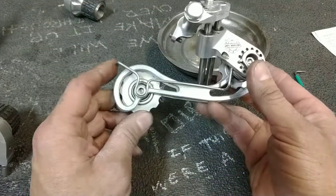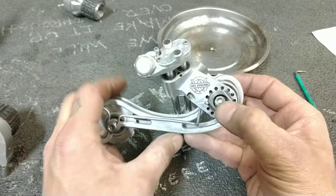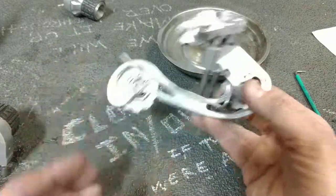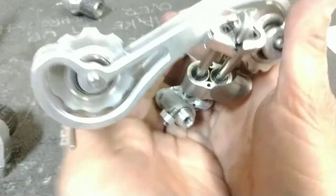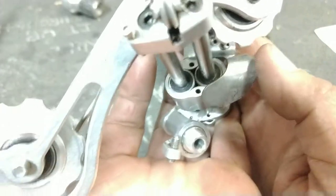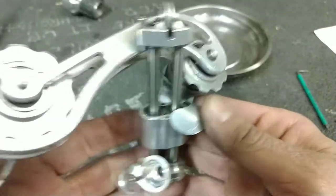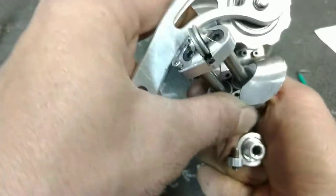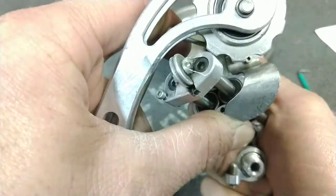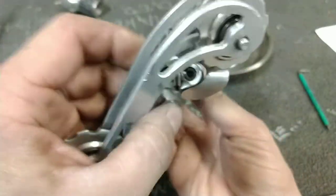So this beautiful art piece-like derailleur, it runs along this double shaft. And it does it in a really strange way. Those are bearings. Rather than having an inner race, the shaft acts as the inner race for these bearings. And so they slide very, very nicely along this shaft. You have a pulley here.